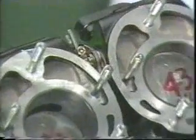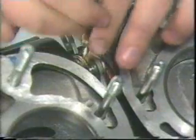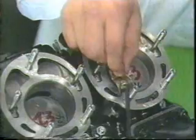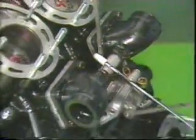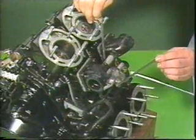The YPVS link can be disconnected from the cylinders by removing the Allen bolt located at the holder. When installing rods, number 1 rod must be installed to the upper cylinders and the number 2 rod to the lower cylinders.